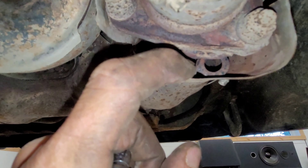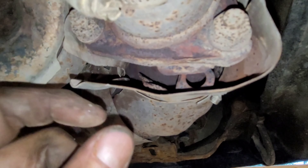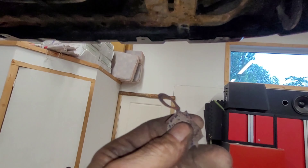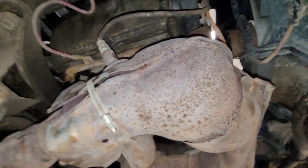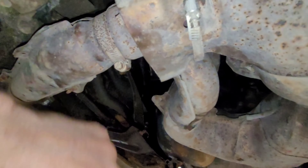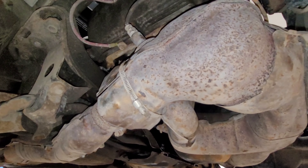Not to mention I'm changing the oil right now, and if this was hot it's some protection to get to the oil filter which is right in between all these pipes. They could have definitely done better, and they did — in the FB motors they put the oil filter on top, so that's been rectified. But I'm going to try and tighten these up a little bit and see what I can do. I think I found it, guys. I just loosened off the clamp — that's what I've got holding it on — but look, there's something inside. It's probably what's been bouncing around and driving me berserk for all these years. Get out of there — what is that? I'll bet that's all it was. It rotted off and fell inside. Maybe that's all it is. I'm going to keep cleaning it out, tighten it up, and see if it gets better.